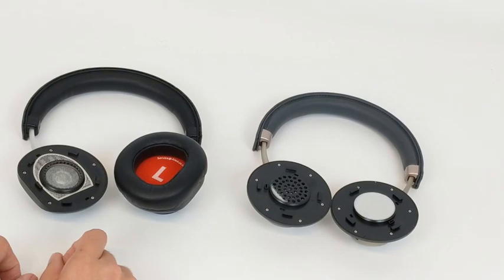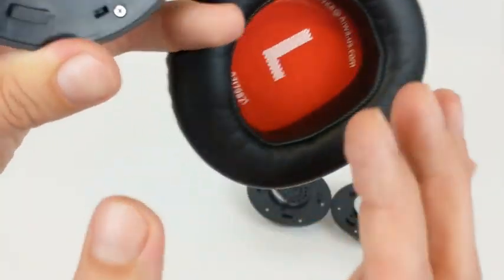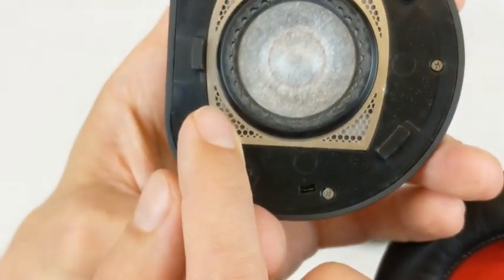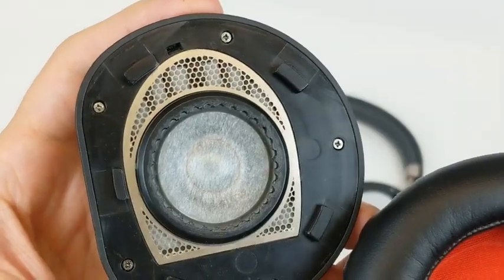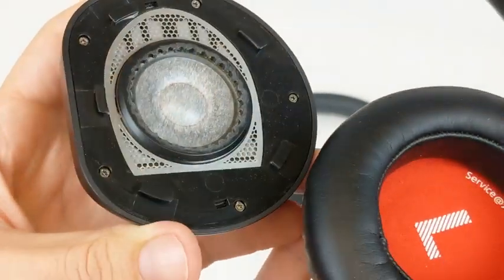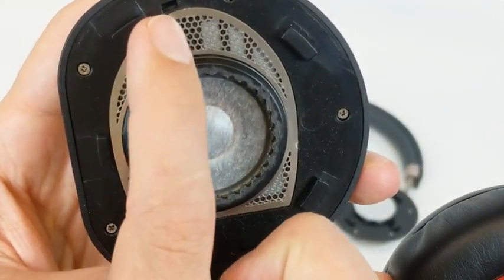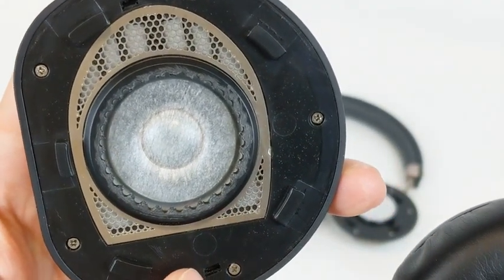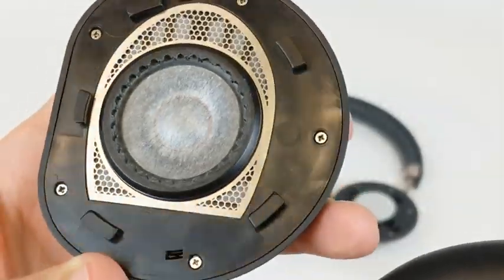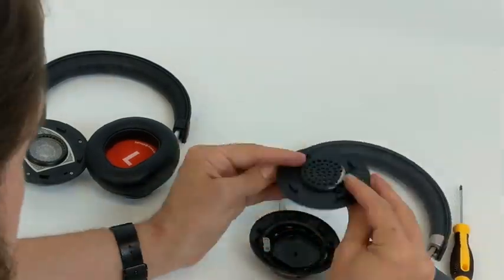For example, these holes in the front plate are a bit like the ports in a box speaker. It's covered with some fabric, and the fabric's density along with the size and number of holes have a big effect on performance. The cavities on both sides of the front plate communicate through these ports. This modulates the pressure, which then reaches your ear. The parameters of these ports were chosen to maximize this pressure over specific frequencies in order to maintain a balanced performance. If there's too much resistance, then you lose the responsiveness of the driver. Too little, and you'll have resonance and peaks where you don't want them. The whole system works in concert — pardon the pun — and it's a combination of science and art that goes into tweaking all these variables.